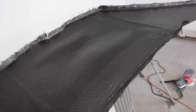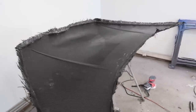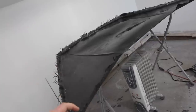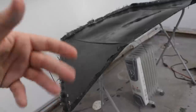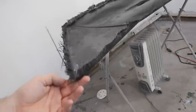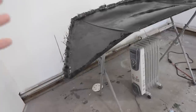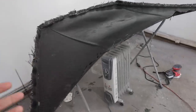Now, we actually did just now figure out that this method that we were gonna try isn't going to work out. So I was calling this the Bandito Light method, because what the street Banditos do is they take 3 to 4 layers of carbon fiber, and when they lay the first one up, and then when that one is tacked up, they go after the next one, next one, next one, and they get 4 layers of carbon on. Now that's gonna have some buildup around the edges that is gonna make your panel a little bit wider, which we knew about, and we're not too worried about that. You can just make the whole car 3 millimeters wider. It's not a big deal.